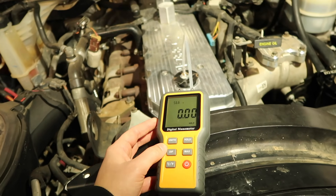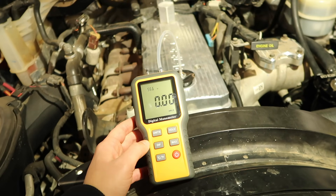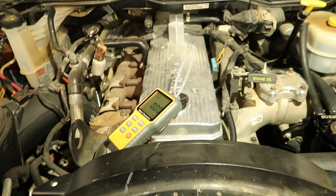Keep in mind, heavy blow-by — the high out-of-parameter spec is over 12 inches of H2O. Now, this is all on a cold engine at idle. This value will change dramatically based on idle, high idle, load, under load, hot, cold — you name it. So for the sake of the video I'm only doing it all at the same idle so everything has the same setup. If we were doing a true blow-by test, I would go through at 1100, 2200, and 2500 RPMs, do them under load, take the average of the three, and that's your actual parameter.